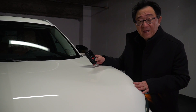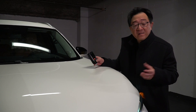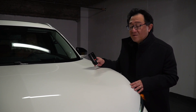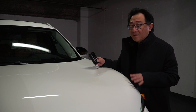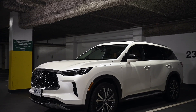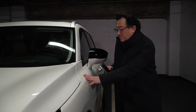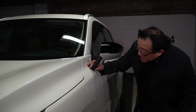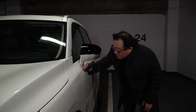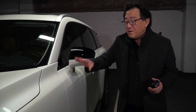It's at 117 microns here, which is pretty well standard — it should be between 100 and 180. The thicker the paint, you can argue it's a little bit better. But with efficiency and focus on cost reduction these days, paint and car manufacturers try to reduce the paint as much as possible. Keep in mind that as you go from top to bottom, the paint thickness varies because of the way paint manufacturing works. The front fender is 107 microns and the door is 108 — consistent but a little on the thinner side, which is common on the side panels.